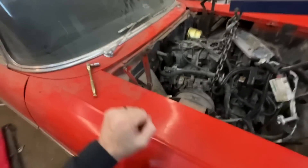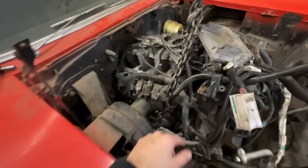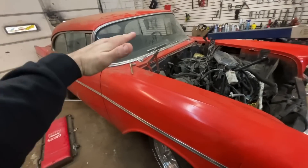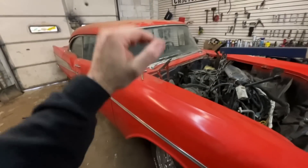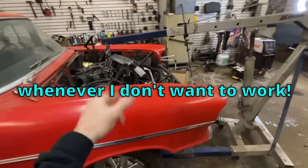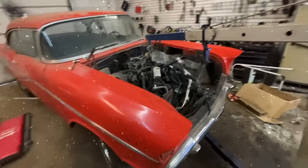The next day — we are back on the beautiful 1957 Chevy. I left here yesterday and could not get my mounts to line up to the frame all the way; the motor is in there a little crooked. The goal is to lift it up, get that mount over to the frame, tack weld it, then get the other mount over to the other side and tack weld that. I also need to check the transmission tunnel — a guy who does a bunch of these swaps told me to add about an inch to the transmission mount so it drops lower and you have no problems with the driveshaft tunnel. This car has a very nice interior and I do not want to have to cut it up. It is also freezing — I can't feel my fingers — so let's kick the heater on and get to work.